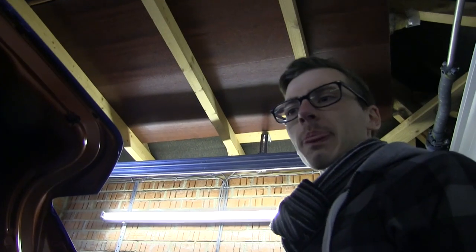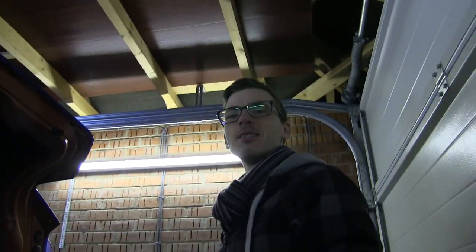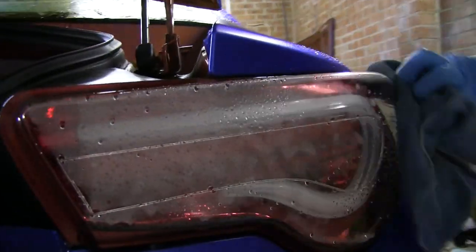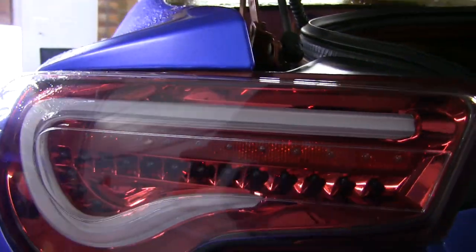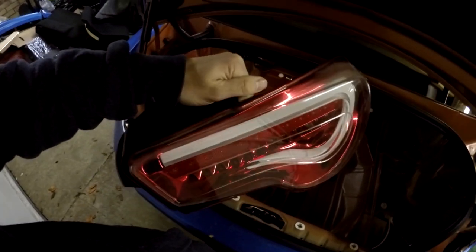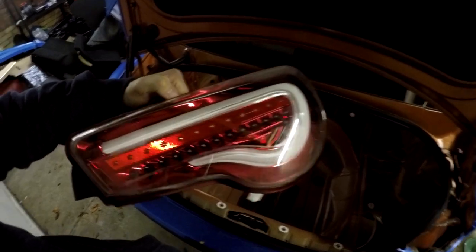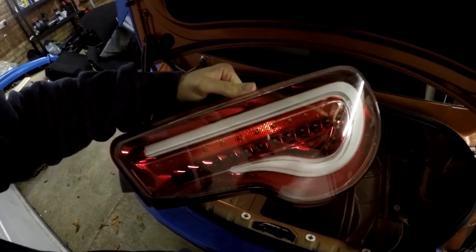You think the silicone's a good plan? Well, what else? We can't really get any new foam - silicone's probably going to be the easier option. But we've ruined this light a bit now. The amount of water that got into it - it's just fogged up. Compared to the other one that we didn't touch. So we might have to dry that out a bit. After three days of this being on a radiator, it's finally pretty much dried out - there's still a bit of moisture at the top, but it'll do. Going to stick it back in and put silicone all around the back part and see if it stops the water getting in.